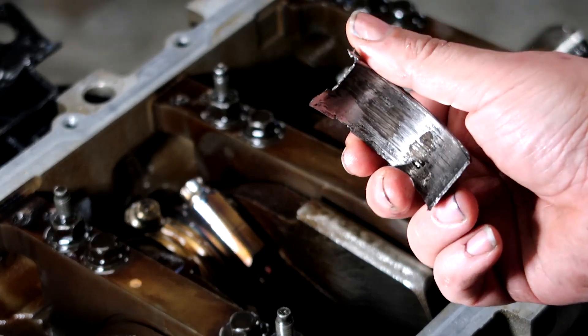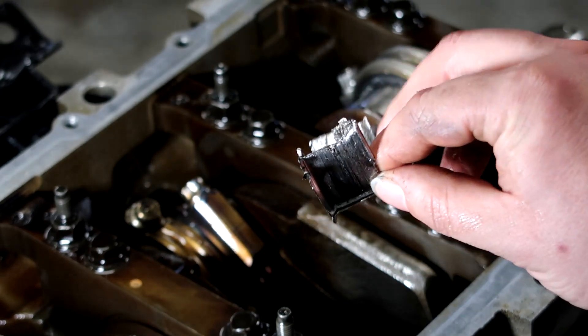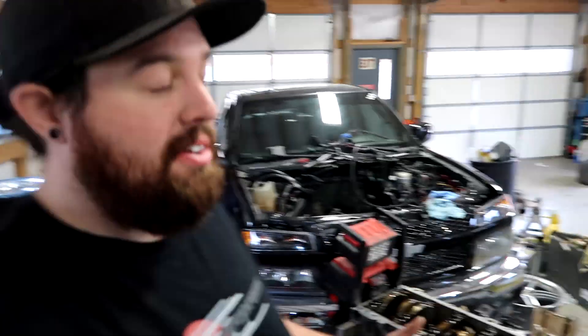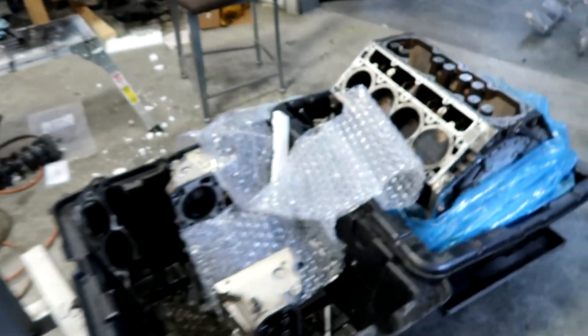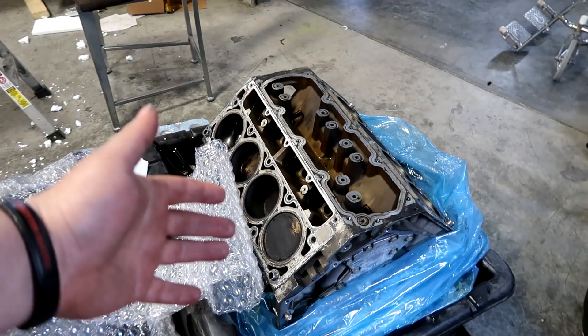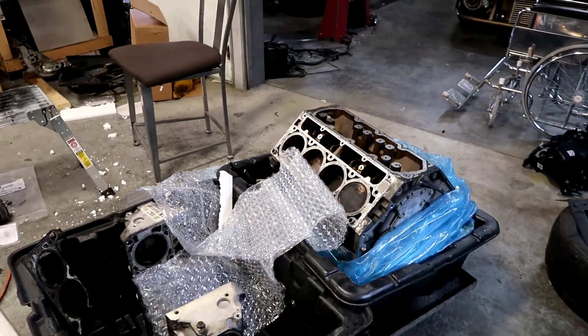She's seen better days. I guess that's the end of the road for this motor. It's been through hell and back - this thing's been overheated numerous times, never once had the deck machined. It's had a hone job a couple times, we've gapped the rings, but I think that motor's finally just said enough's enough. We got this contestant up next - whether we keep the stock gen 4 internals or go ahead and put some more cheap rods and pistons in it, I don't know yet.